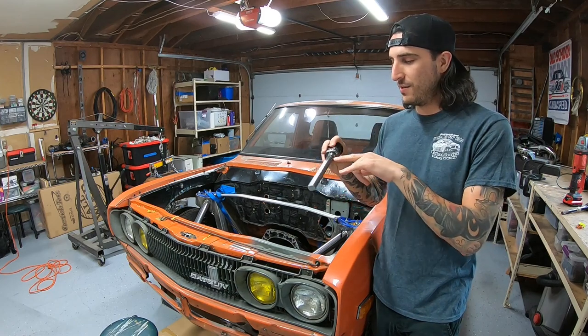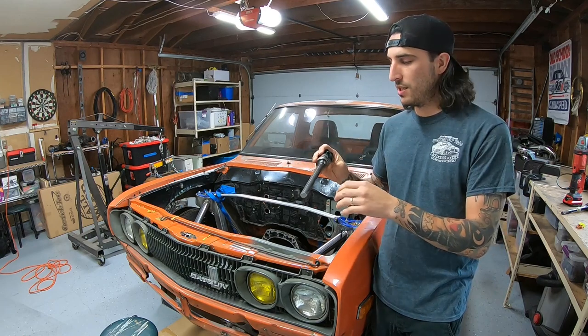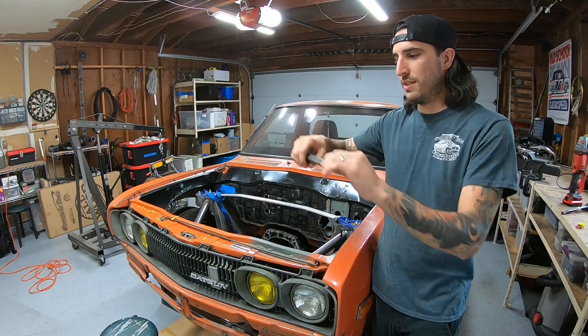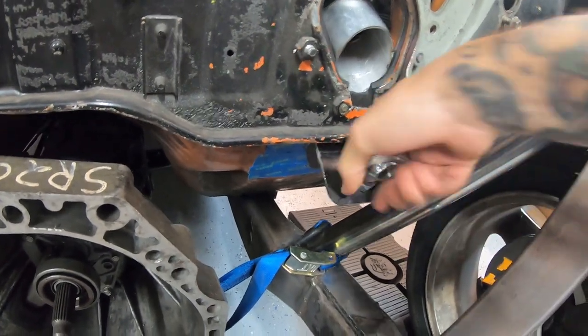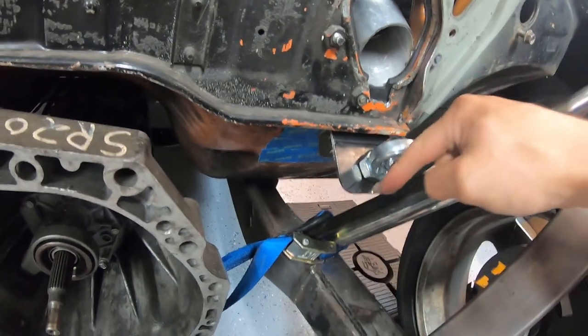It was pretty nice to see the steering move with the wheel, but I knew I didn't do a perfect job. This was a little bit out of round from center on the rotation, so as it rotated it was moving and flexing the mount I used for the bearing support. That would eventually just straight up fail, so I had to come up with an idea.